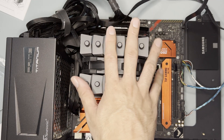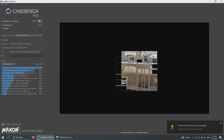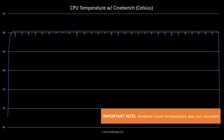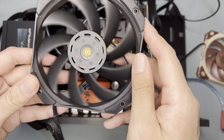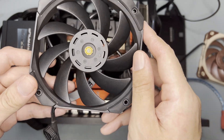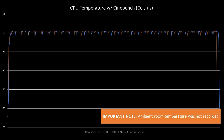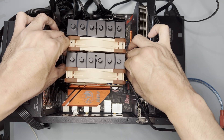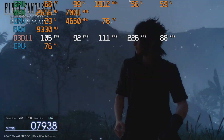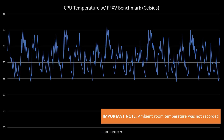Mounting-wise, I'm very happy with this cooler. Time to test it. For the benchmarks, while running Cinebench R23 the SS135 was at 90 degrees Celsius with its stock fan. However, the stock fan was too loud — it could be heard six meters away. I replaced it with a Noctua fan; it became quiet but did not improve thermal performance. I also added another 120mm fan at the back, but it still did not significantly improve thermal performance.